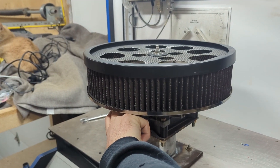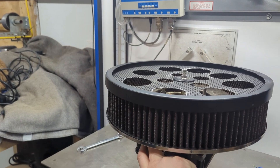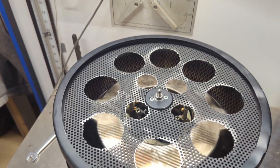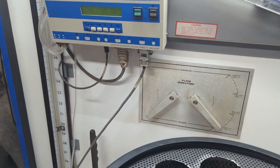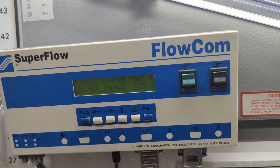The next step, we ran it again without the media. We got back about 19 CFM from the media being removed and 13 CFM from just making the holes larger in the mesh. Both restrictions work together, but the biggest gain in our case is just removing the media.